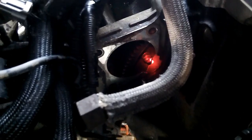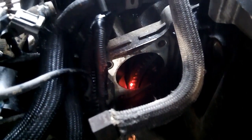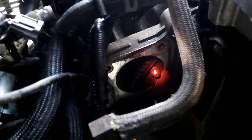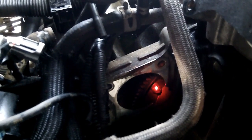Let me get a flashlight. There's a screw there, looks like a 12 millimeter, and there's the cogs of the flex plate right there. So those screws will only present themselves when you turn the crank, and that will in turn spin this. And I believe there are 4 bolts that I'm going to have to remove through here, through the starter cover. I kind of figured that out by reading the 5th gen manual. Fortunately, I'm fortunate enough to have a 5th gen manual.